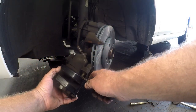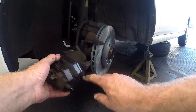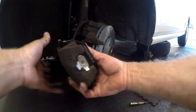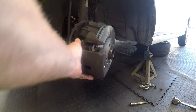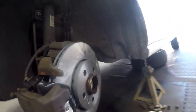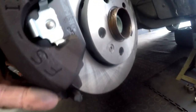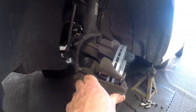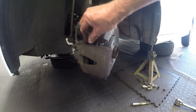Make sure you push these units back all the way before you fit them. At the bottom you'll see the caliper has to clip in and then push down — let me take you closer. This unit has to go in and drop down behind, then push it and you'll feel it's spring-loaded. That spring load will prevent the pads from rattling.